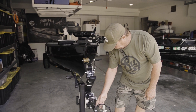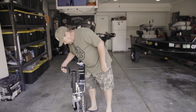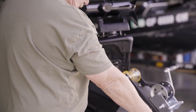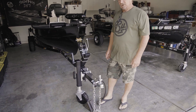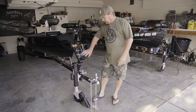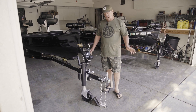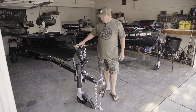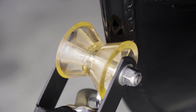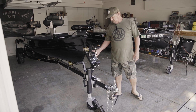All new wiring throughout the whole entire trailer, all hidden inside. Brand new heavy-duty third wheel that works with ease — it's rated for a 2,000-pound tongue weight. I think overkill is cool and it looks good. It's the same one that's on that boat there. Up front, the post and winch assembly is all completely new. All the rollers on the boat are neoprene so they don't cut — not the black rubber kind that split and crack. They last forever. Brand new safety chain.